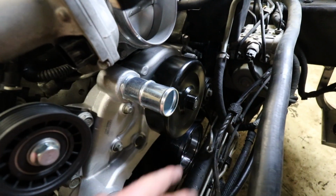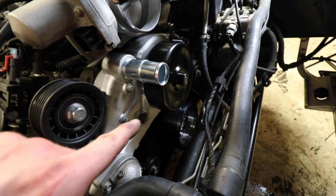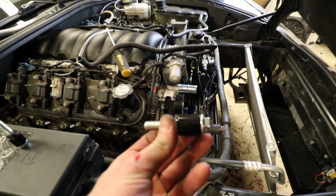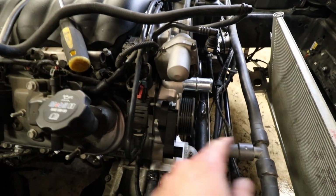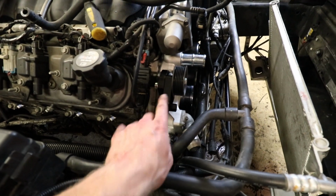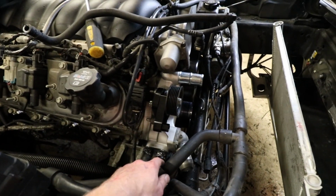Water pump is in. So for the 6 water pump bolts, the first torque spec is 11 foot-pounds. Go around, do that, and then you finish it off with 22 foot-pounds of torque. And then I did realize once I got this on here that these spacers right here are actually probably meant for the truck to kick it out a little further. It was just sticking out too far. So I went ahead and had to pillage the bolts that were holding in the original belt tensioner on the old water pump, and they fit just perfectly.